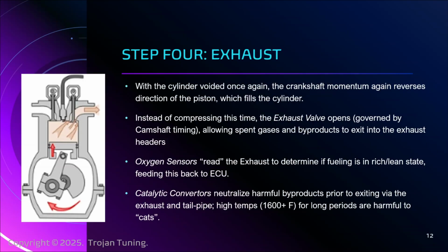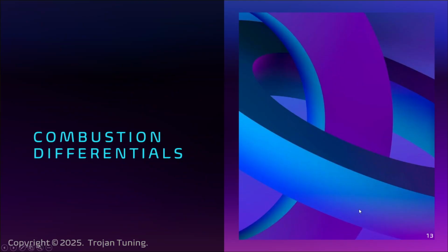But if there isn't room for that second oxygen sensor, guess what? You get a check engine light, because it's not able to monitor the whole process here and make sure that everything is running right. And that's where you have to go in and get rid of the code or figure out a workaround, right? And then the other problem, we'll talk about later. We'll keep moving on for now. Just remember, catalytic converters. Okay.